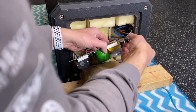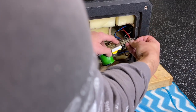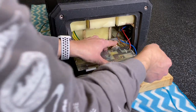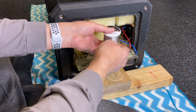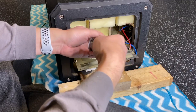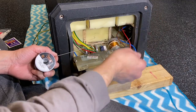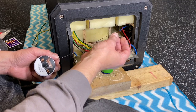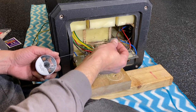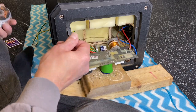Okay, looks good. There's our gray. And our final one now, the red. Sit like that. A little bit of flux. There's flux obviously in the solder already, but I like to add a little bit extra, particularly for something that's a larger weld that requires a lot of heat. You're going to have that iron on there for a longer dwell, and it's just going to burn up any flux that's in the solder because you're using so much heat and leaving it on there for so long. So adding a little extra flux is really going to help quite a bit.